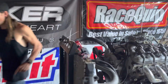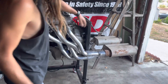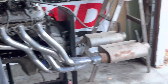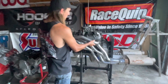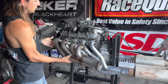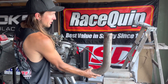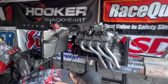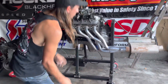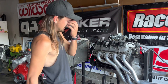The A-body headers and the LS1 T56 bell housing are going into the El Camino, so I need those back. I've got up-and-forward turbo headers that I'm going to mount down and back, then run 90-degree bends straight up so I can slip on various muffler setups. I've got a couple sets of stock mufflers to test out so I can compare what different setups sound like.